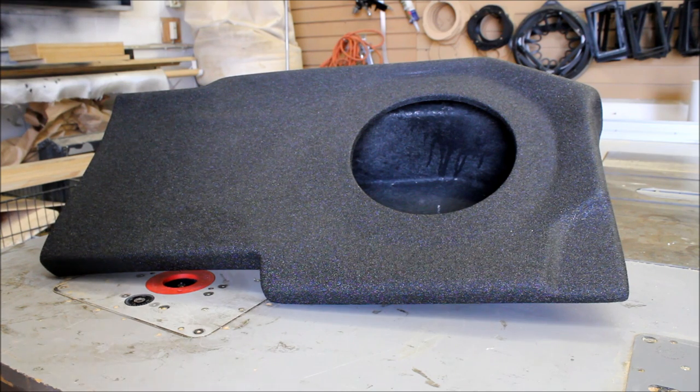Now why would you want to go with sealed? There are a few reasons. Looking at this enclosure right away we can see it's only half the space. For Dodge RAM owners who like to use the left side for keeping miscellaneous items like gloves or tie-down straps, this is the better way to go because it only takes up half the space. Also, with prefab, sealed is a better way to hit lots of different frequencies with more consistent quality, as opposed to a vented enclosure where you really have to pick the right sub since the enclosure is already built.